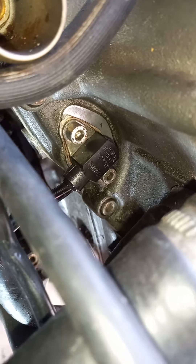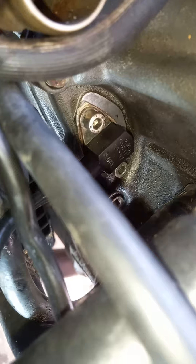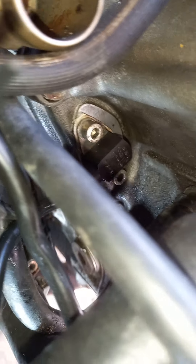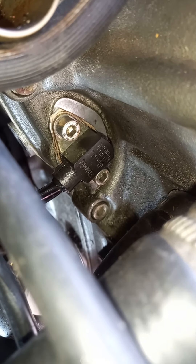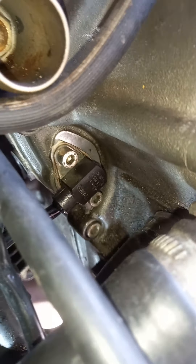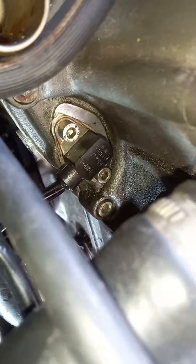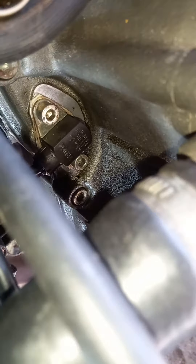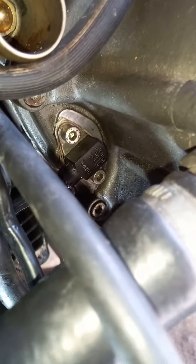If it's fully broken — which I have taken out before and tried — the engine won't even start. But people have said it can break down internally when you've been going about eight miles, and then you break down basically until it cools down again and it's okay. I'm not saying that's the issue here, but that's what I've heard. So I'm just going through the process at the moment to check the actual distance between the crank sensor and what I think is the timing gear.